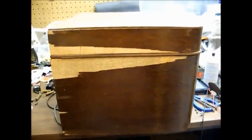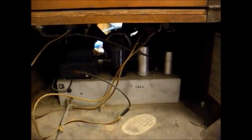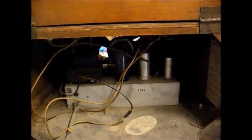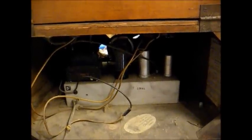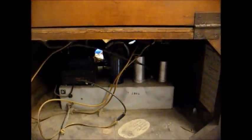Now let's look at the amplifier in this unit. This is a Model 12, by the way. It uses a 4-tube amp that has a power transformer. The chassis is a rather nice size, so it should be easy to work on. We've got a 5Y3 rectifier tube, a 6V6 output tube — which should be good for probably somewhere between 3 to 5 watts, not bad for a table model record player — and then a couple of preamp tubes.